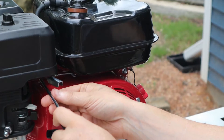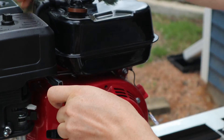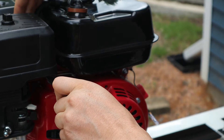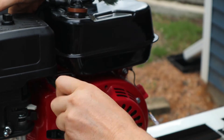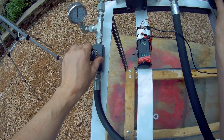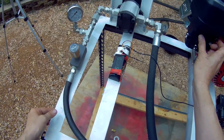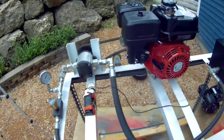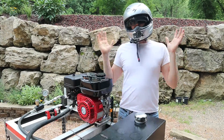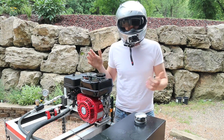All of my comparisons so far have had two compared results: one is straight out of the box, and then the other one is with the throttle stop screw pulled back. It's at 3,600, up to 5,250 to 5,300 RPM max. You really want the dyno results.